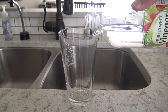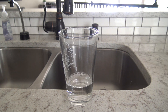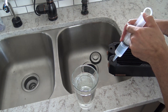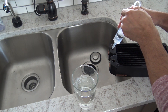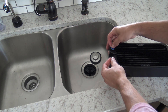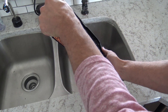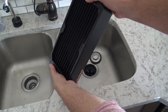First, you will fill a glass approximately one-quarter to one-third of the way with your vinegar, then the rest of the way with hot tap water. Extract the solution from the glass and fill your radiator to about 80 to 90 percent — you want to leave some room for the liquid to slosh around. Then plug the ports and gently tilt the radiator back and forth. You should hear and feel the liquid moving through the radiator. Usually doing this about 10 times is enough before you let the fluid drain out.